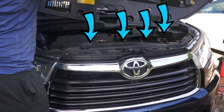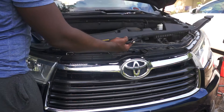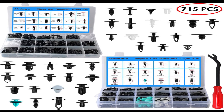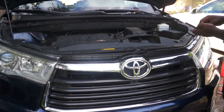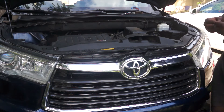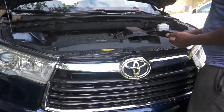Then you need to install those four clips at the top right there. And remember, there are also three clips below those four clips — one to the left, one to the right, and one in the center. It is nice to have excess clips, and you can purchase a kit like this on Amazon — I will put a link in the description below. All I'm doing right now is reinstalling all the clips that I removed when removing the bumper from the car. This is the easy part — all the hard work has already been done.